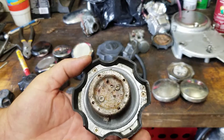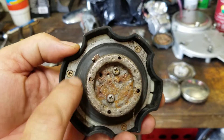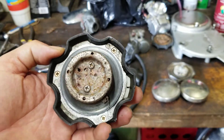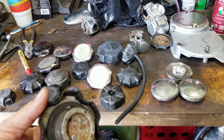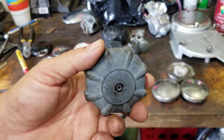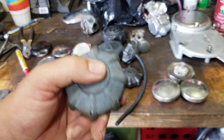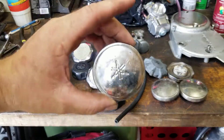Here's the newest style Kawasaki cap — there's the vent, it's different. There's the vent right there, and here's your primary hole where vapors go up through. If you look at these caps, they've got a couple of screws — you can take these caps apart and clean them regularly. On Kawasaki KEs, KDs, KMs, and similar models, there are four screws. You can take it out and clean the bath well.